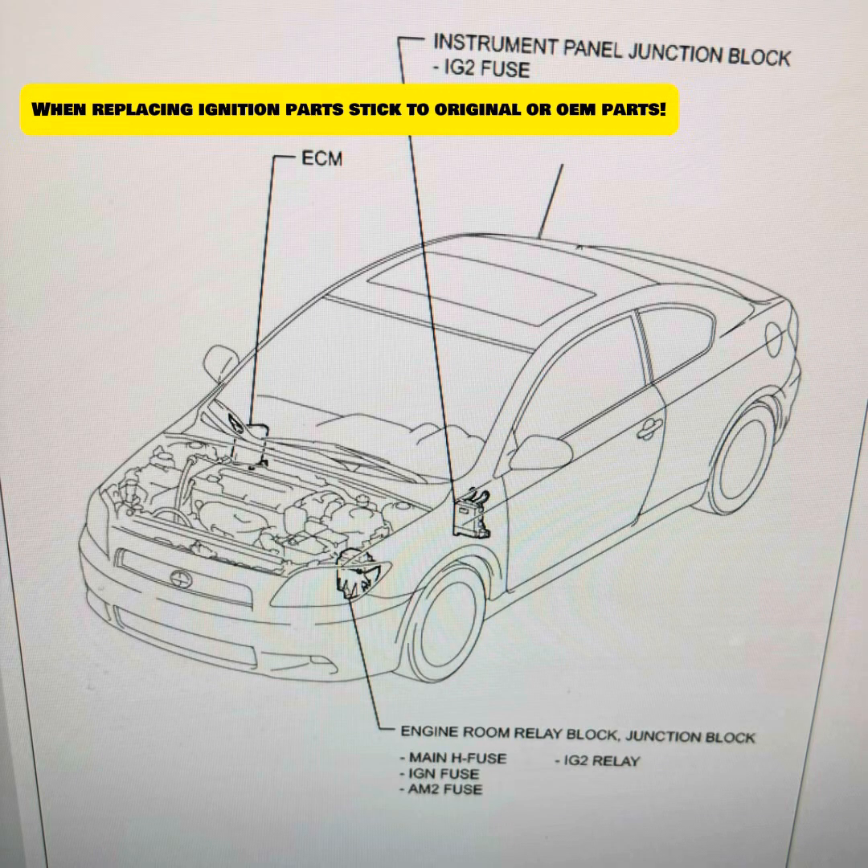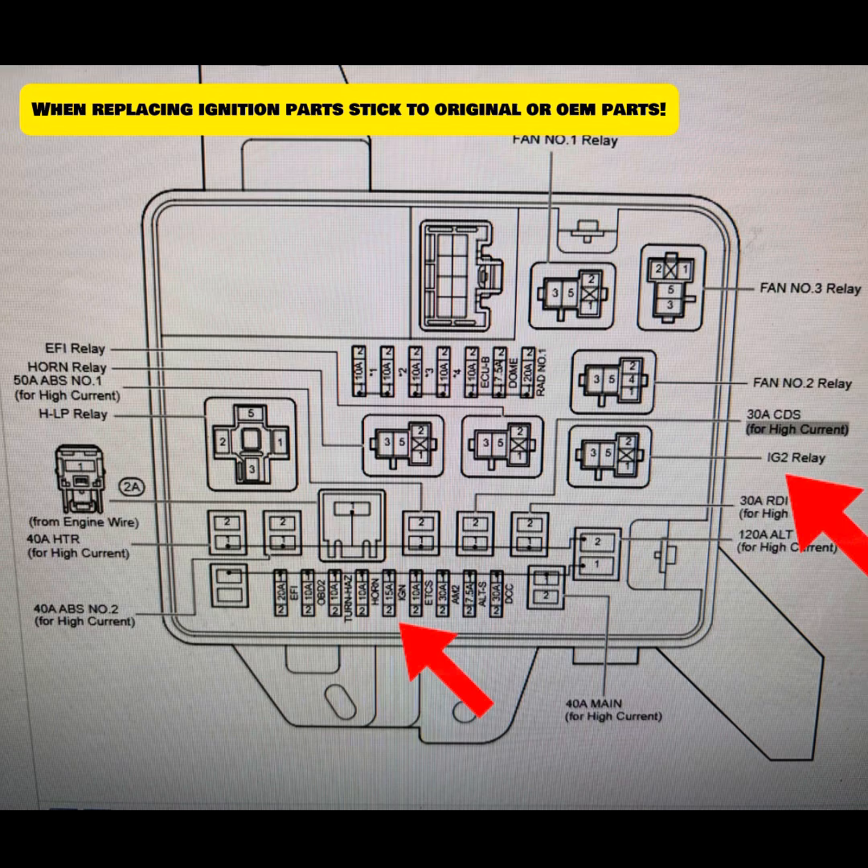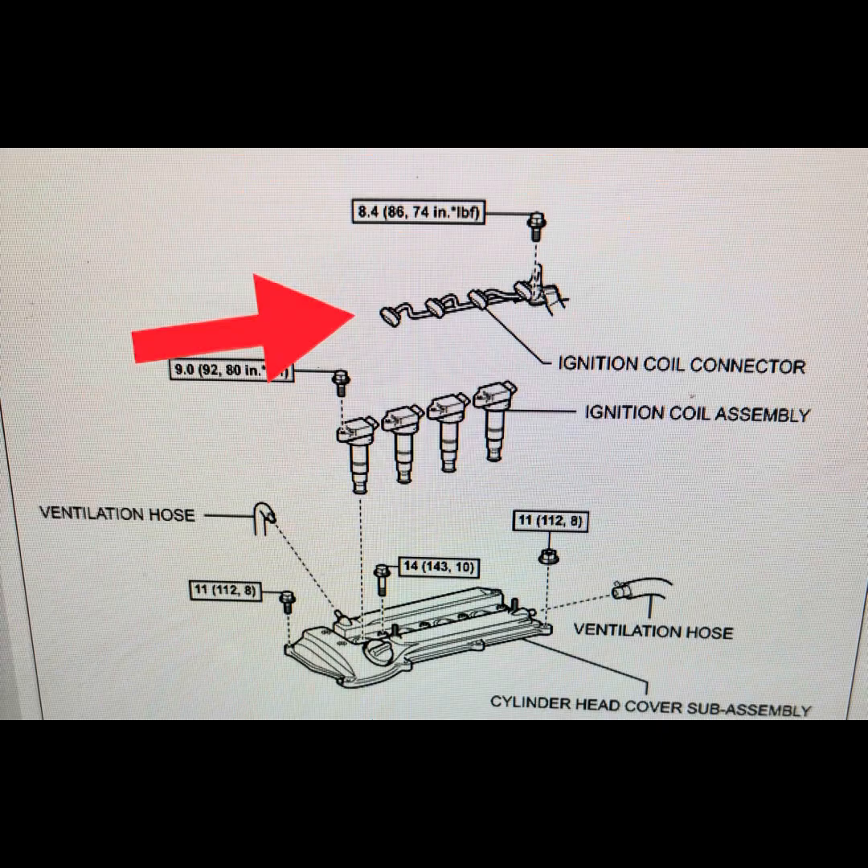The reason I'm showing you these items on the screen — like the ECM, the relays, and the fuses — is that in the case that they do fail, you know where to look for them. Also, if you want to inspect or test one of these items, this can help. But word of advice: do not change any component until you can confirm that that component is what's failing.